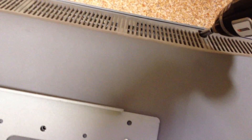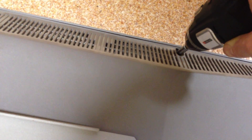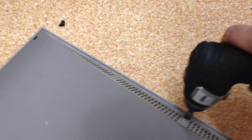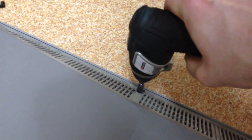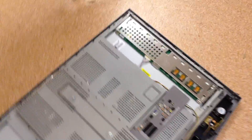There are a few screws in the middle of the television — some need to come out, some didn't, but I took them all out and it does no harm. Some connections like the SCART connections may have screws in them, so check those. If you go to lift the cover and it lifts in one area, you'll know where you still need to take out more screws.